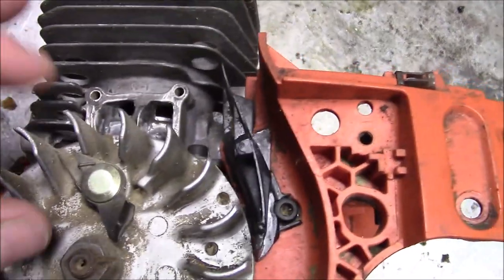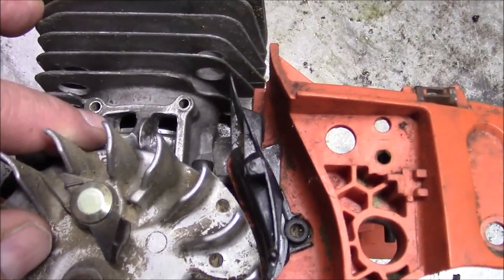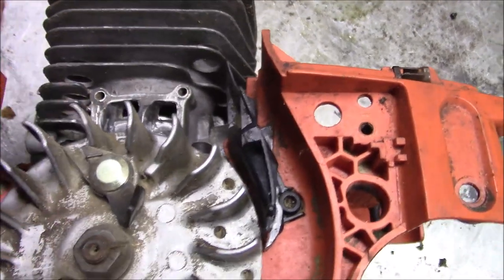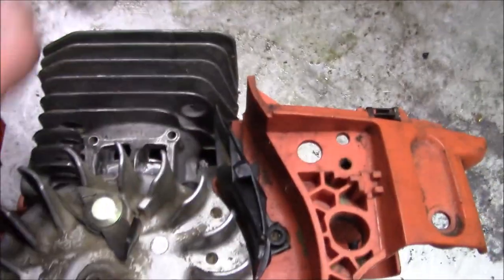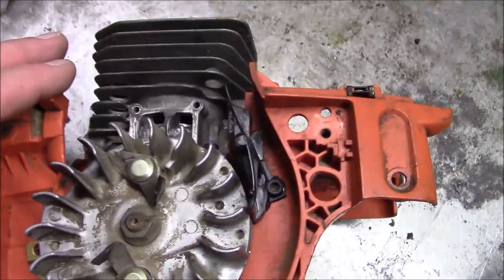Okay. Now another little tweak here is, because of that square edge, there's a turbulence, and one of the modifications that's pretty common when a person modifies that roof is to angle that roof up, say, 30 degrees.